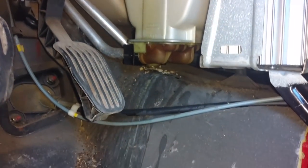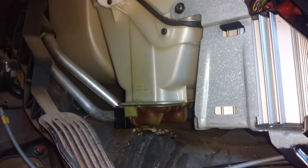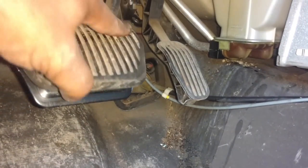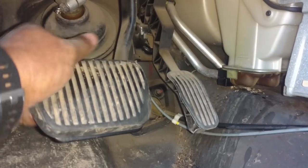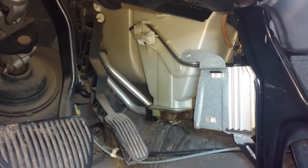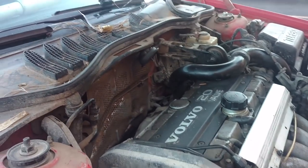Let's get this amp out of the way and the other side out of the way. The last thing I'm going to do is clamp the hoses right before I pull that screw out of there, so I'm going to have everything out of the way before I clamp the hoses — don't like to leave them on long. The brake pedal isn't even right — how the heck did that happen? Let me get that sorted. I also forgot I have a thermostat to put in this car, so I'm going to go ahead and drain some of the coolant out of the engine and not even clamp these lines. Got the new battery clip installed; I'm going to pop this thermostat out and then pull that heater core out and swap it over.